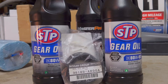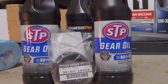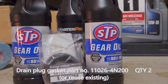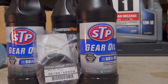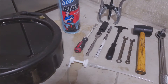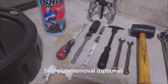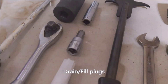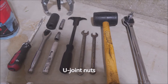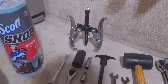When you make your parts purchases, you're gonna need to pick up the oil seal. This particular part number matches this year of Xterra — I would imagine they're all about the same. You're also gonna need about 83 ounces of 80W90 gear oil. Tools needed include something to catch the oil, something to wipe up oil, a screwdriver to hold the u-joint steady, a 27mm socket, a 10mm socket, a 10mm Allen socket, a transfer pump, seal puller, 13mm wrench, 14mm wrench, torque wrench, a mallet or dead blow hammer, and some pullers.